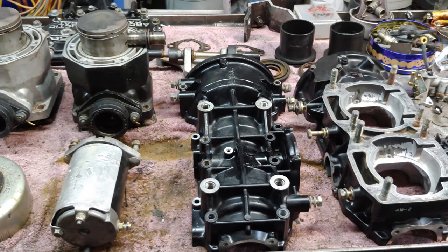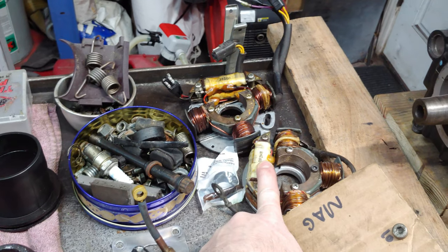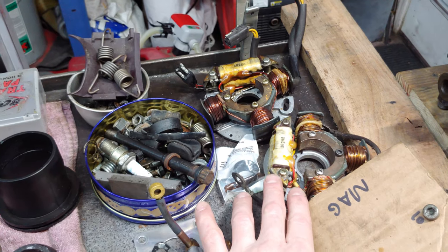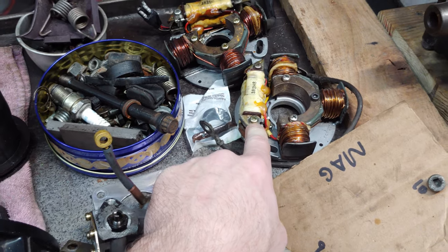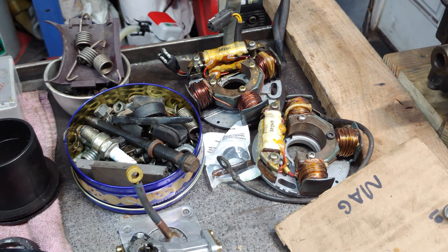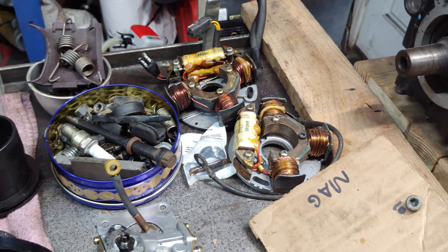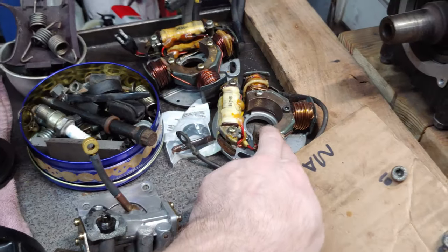As you saw in a couple of shorts — go ahead and check those out — the first thing I discovered was it got started, ran for like a second and a half, and then shut off. I checked spark — it's done. I did the normal procedures and ended up finding that the stator was bad. I believe it's the low speed coil — didn't have any continuity, somehow it lost continuity. I ended up getting a new stator. Thanks to Dane Vancura — appreciate it buddy, I'll get you back on that one.